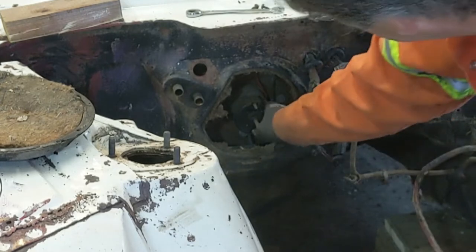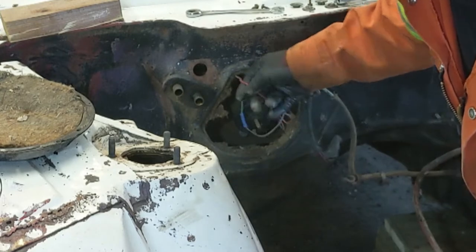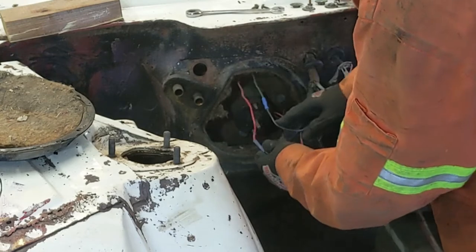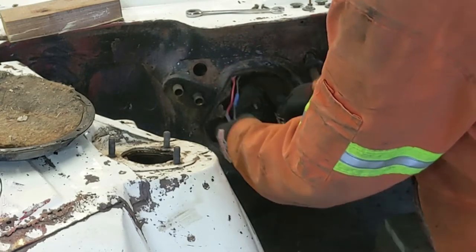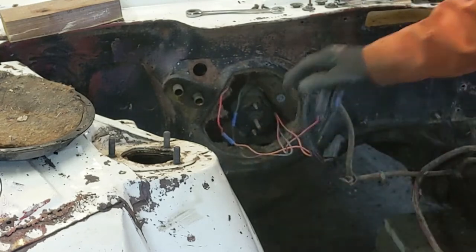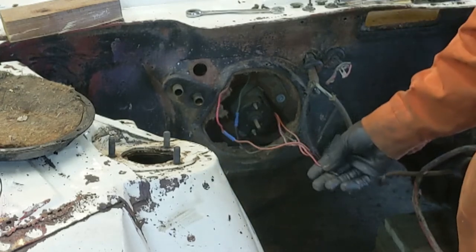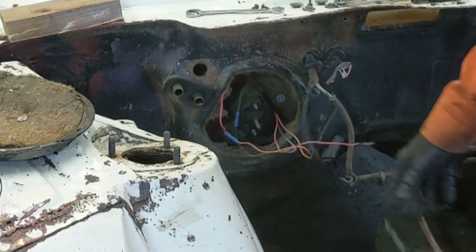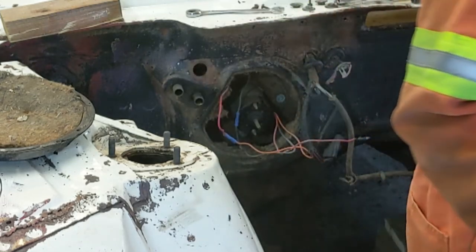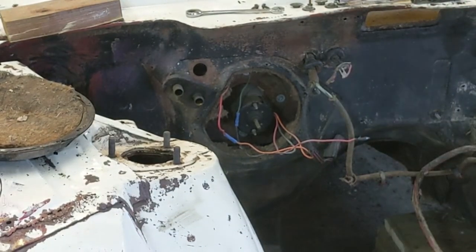I'm gonna grab a screwdriver, we'll pull the fan out while I'm here. Someone's changed this fan. And then they, of course, they've done the old butt joint controller here. Lovely, no big deal. We'll fix that up. One wire completely unhooked. So it's highly unlikely that's the right fan motor. Or if it is, it's not running on all the modes. But I have one in the 60, the parts car, the green car. We'll pull that out and see what's inside there.